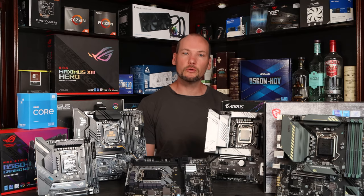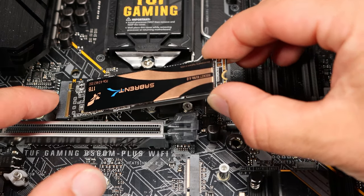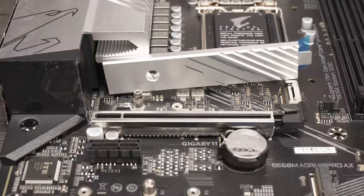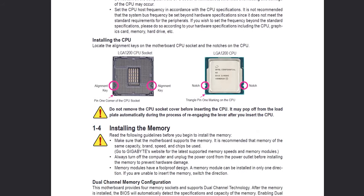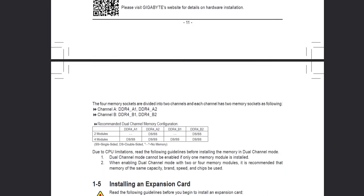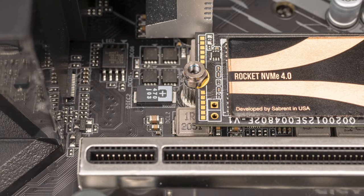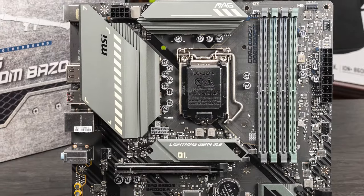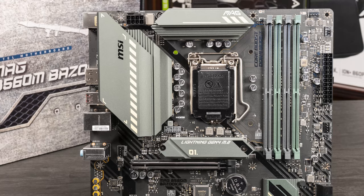Let's talk a little bit about the ease of setup and install in terms of their physical design and layout. Full marks here go to ASUS for their M.2 clip, which makes drive installation a cinch. The manuals are clear and accurate, and they have integrated backplates. The Gigabyte also has an integrated I/O plate, but it loses marks for its M.2 installation solution with a split standoff — the heatsink looks like it's hinged, but it's actually just a tab. The awkward process is exacerbated by a manual that doesn't have clear diagrams or even reference the M.2 installation procedure. It's outdated and can do with a refresh to help first-time builders along. It is actually possible to get this M.2 installation wrong, so take a look at my reference image to show how it should be set up. The MSI Bazooka has a separate I/O backplate, but the M.2 installation is easy enough and the manuals are clear. Post lights help diagnose any installation or settings errors.